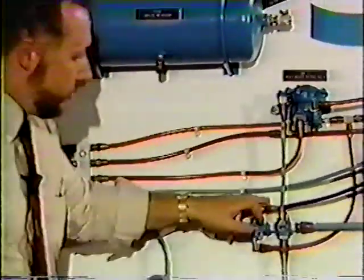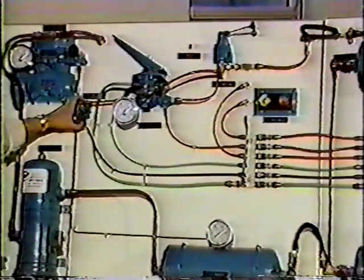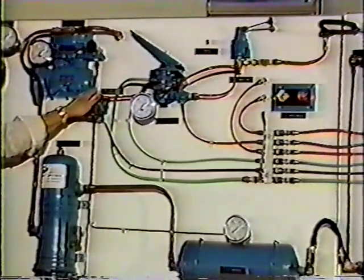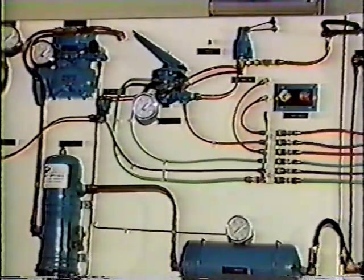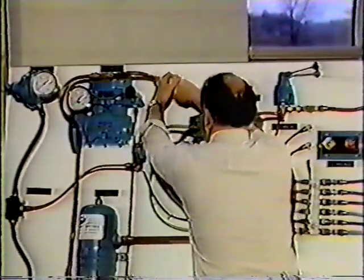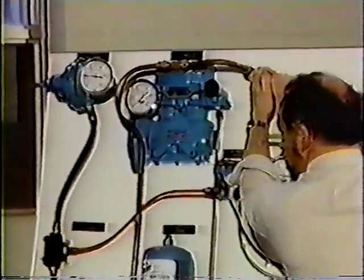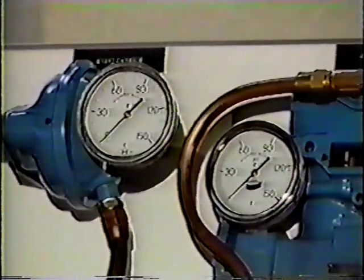Now, if you're watching, you notice there was another black line. Follow that black line here, and that was our limiting quick release valve, which we will now call our BP1 front axle valve. The best way to see what happens up here is to make another application. Remember, before, we made an application here. If I delivered 30 to it, it would only deliver half of that to the chambers. So in this case, I'll deliver 30, and if you look at that gauge on the front axle, it is also delivering 30 to the front axle brakes. 60, it delivers 60 to the front axle brakes.